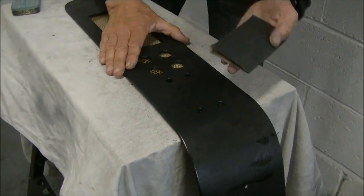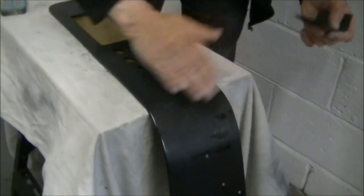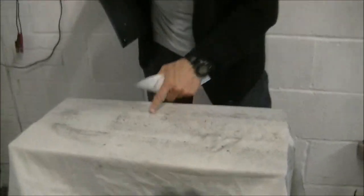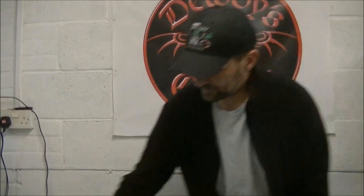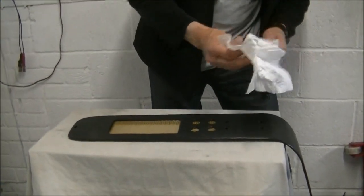Just to prove that this paint isn't working — it's not even dusting. What it's doing is forming into little curly bits like shavings. So this is almost like a wrap in its own right — it's rubbing off like a plastic. There's clearly something that's cocked up with that paint, which is a shame, but we'll get it nice and flat and wrap it. As you can see, it's formed these little plasticky swirls rather than dust. Normal paint when you sand it you get dust, so it's definitely not gone hard by any means — it just will not cure. Let's pop that down, clean it, give it a degrease, and get it masked up ready for painting.